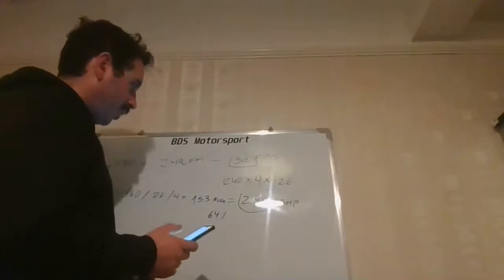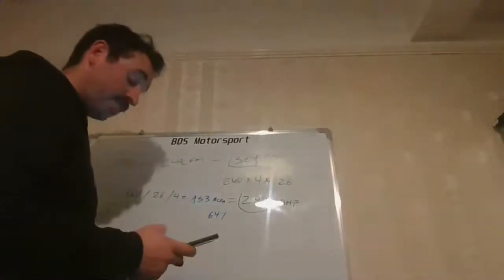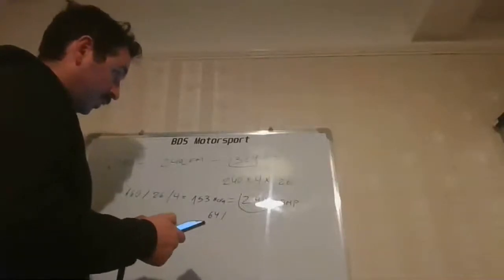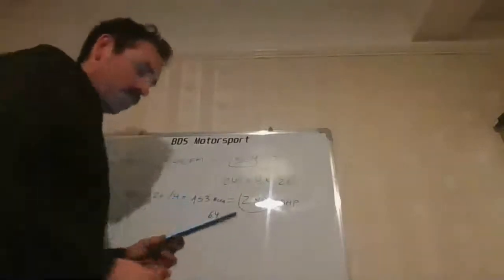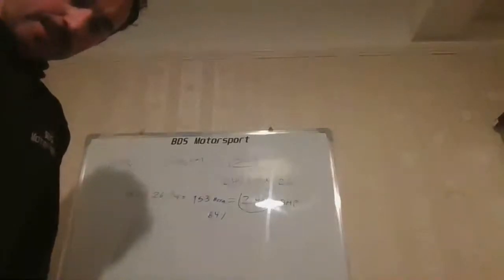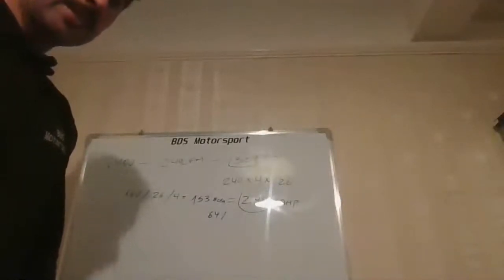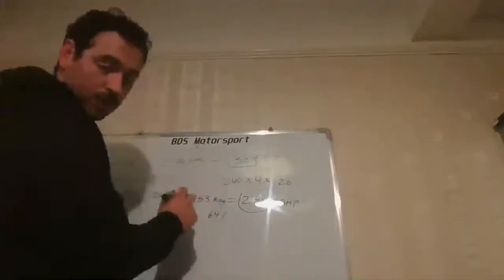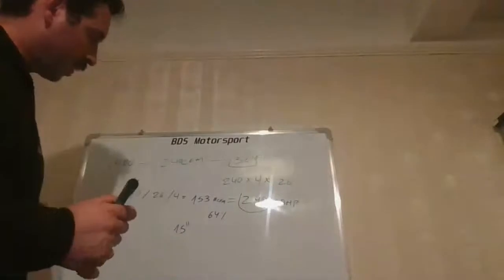I know it's 1.3. Now, these conversions I know by heart, so I'm going to do it, and I'll tell you when I'm sure it's the right one. 1.43. So if it was 10 inches, it would be 1.43. So it's more than that. I said it would be around 12. I think 12 is 1.6. And it's very close, not 12. Okay, 1.56. So the sucking pressure of the engine to make this power is 15 inches drop. This is the way you measure the vacuum, the suction of it.